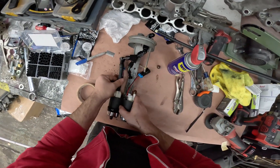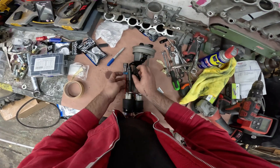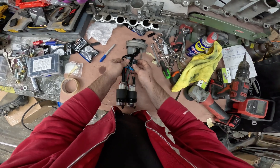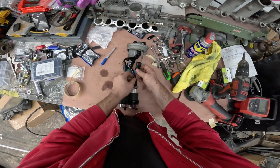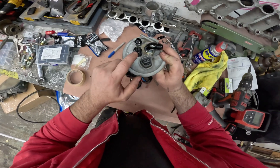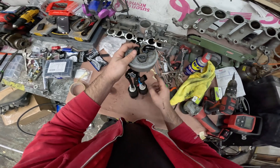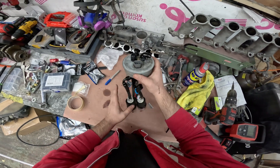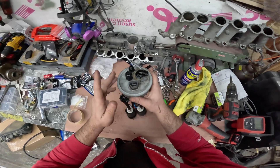So this is pretty much what it's going to look like. The electrical wiring is going to get sent through this electrical bulkhead right here — each side is going to be each pump. In the car I'll wire it up through a set of relays: one relay is going to come on as soon as you click the ignition from the ECU, and the second relay the ECU will kick in depending on what boost settings we decide to run.